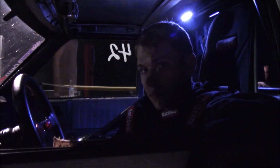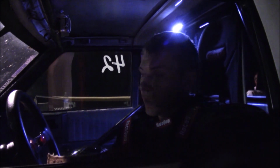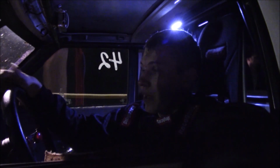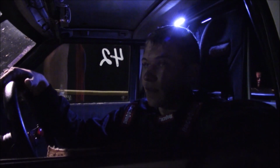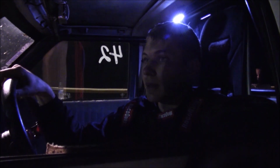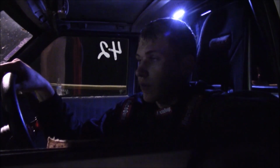Someone else asked, is Tommy's truck on E85? If so, was it easy to set up? I ran a fuel-injected car with a turbo. Now I'm building a carbureted small block. Yeah, Tommy's truck is on E85. It actually has the carburetor that came off of my truck when it was on nitrous. It's a Quick Fuel 1050 carburetor. Yep. It's got the E85 metering blocks, the green metering blocks. My dad tunes it all. It's pretty basic, honestly. Just get the E85 conversion kit and convert it over.